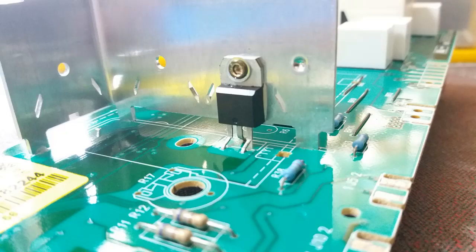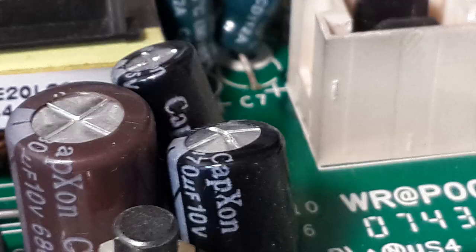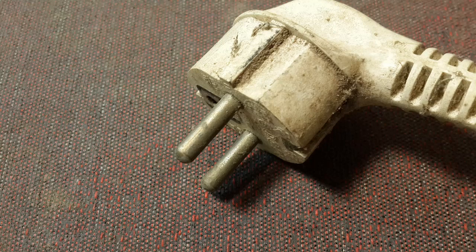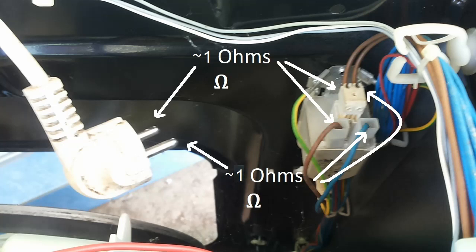Truly, most problems with motors are related to the triac, lacking contact, or bad contacts in relays. Remember, 70% of the issues with washing machines will be defective electronics components, but 30% are related to bad contacts — and bad contacts could be anywhere. We sometimes forget to start right here. Here we have the first serial resistance with the washing machine. As an example, this connector is already creating a serial resistance. Our serial resistance should always be less than 1 ohm.